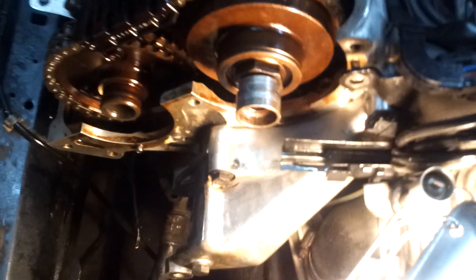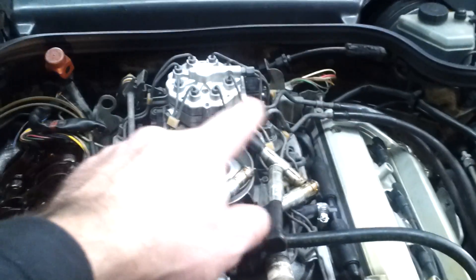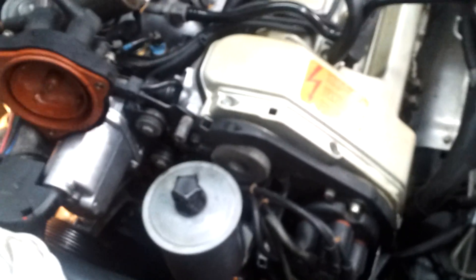While at it, I had to clean up a little bit underneath here. This was kind of involved because the alternator had to come out to get to the timing chain tensioner. The camshaft had to be locked in place, so this cover was removed — I already put it back. Fuel lines come off, vacuum booster comes off, the crankshaft ventilation comes off. On this side, just the cover, because you need to prop the cams so they don't move or jump.